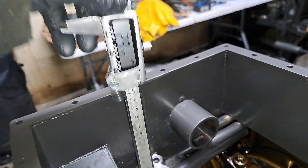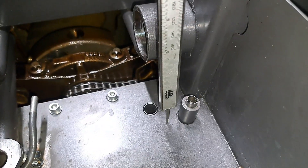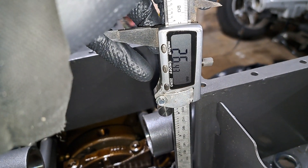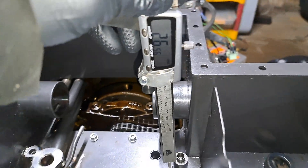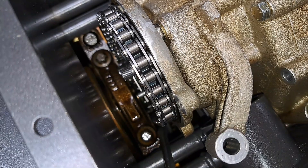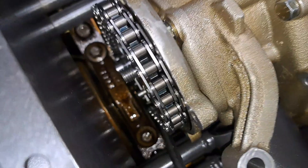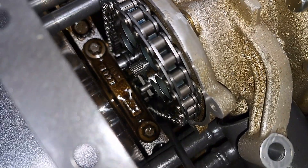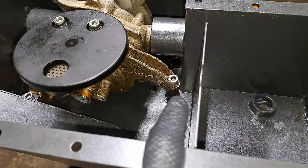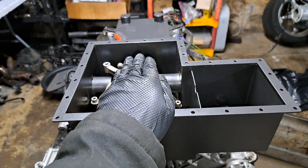As you can see we're a lot better flatness-wise now. This post here measures at 26, so I'm going to show you the oil pump installed without the shim and then with the shim. With the oil pump installed and without the low side shimmed, you can see that play down in there. We now have a copper washer on top of that post directly underneath the oil pump — roughly 1.5 millimeters — and that has brought the oil pump up.